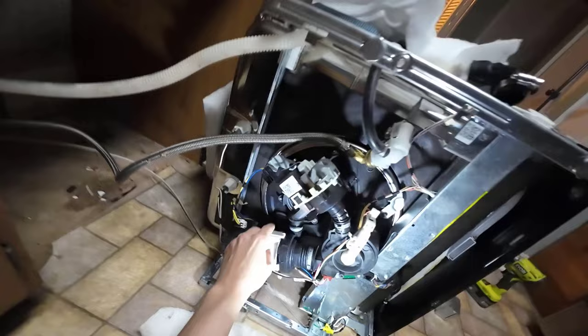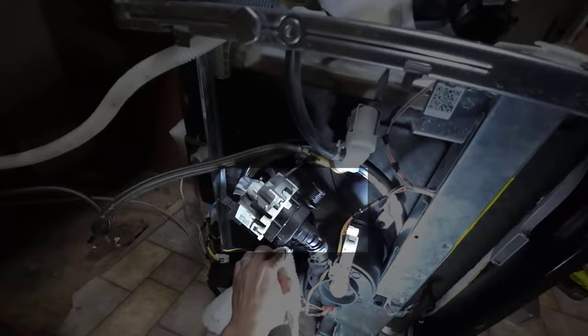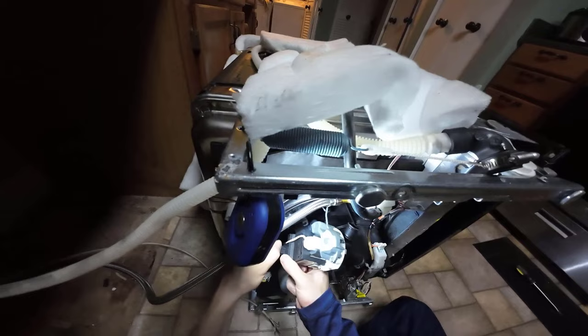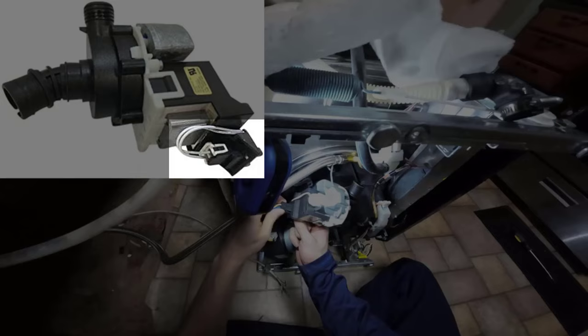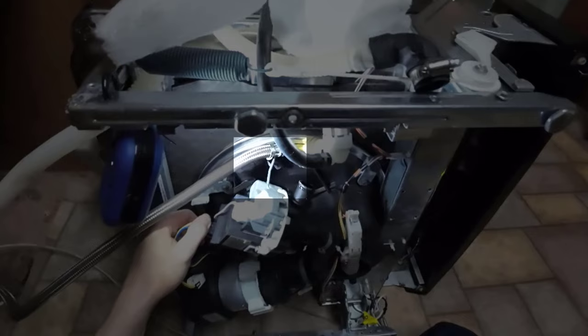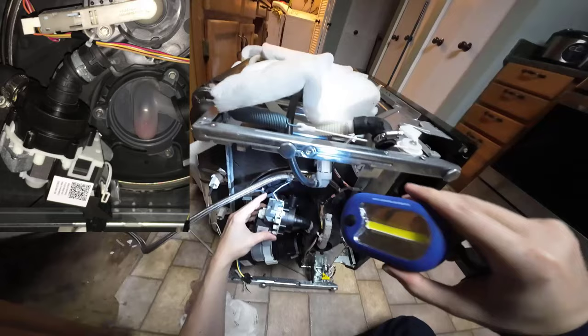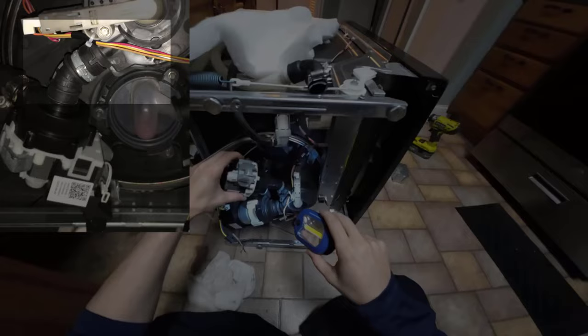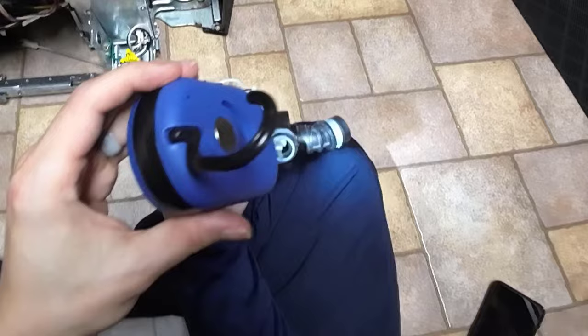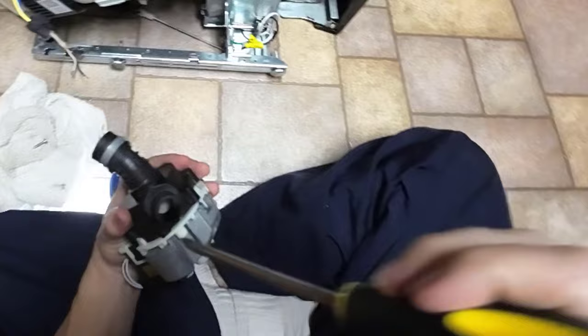Here is the pump — I've disconnected the discharge tube and I'm going to poke around and look for any blockage. I'll also disconnect the electrical wires connected to it, then slide off the L-shaped hook hanging from the top of the dishwasher. Finally, slide off the main rubber input hose and the whole pump comes off. Inspect both the input and discharge sections for blockages.